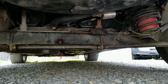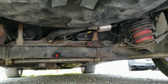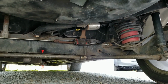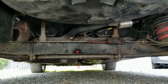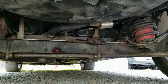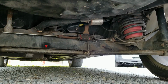But yeah, I've got to do a transmission crossmember, obviously, to make it rear wheel, cut the floor, make room for it, all that stuff. But with just a lower control arm on each side to locate it front to back, put the power to the ground, and then a torque arm to keep it from axle wrapping, I'll just make an extra mount on the transmission mount for the torque arm, and it should be a pretty simple suspension setup that should be really good as far as actual functionality with minimal effort.